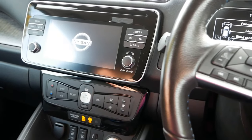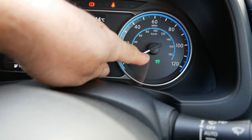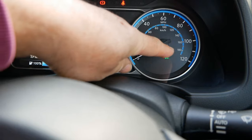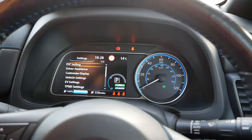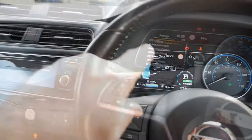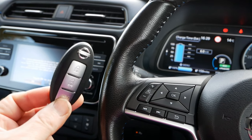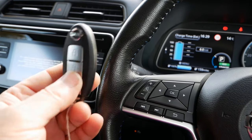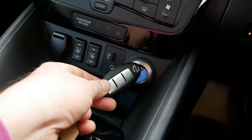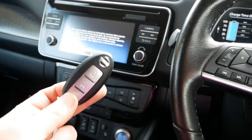When you're inside the vehicle, keep the key in your pocket, put your foot on the foot brake, and push the start button to make the vehicle start. Give it a good three or four seconds to allow it to boot up. When it's ready to go, you'll get a green light on the dash — all EVs have this green 'go' light showing the car can move. If a menu says it can't detect the key, the coin battery in the key is probably low. If you're out and about, hold the key over the start/stop button when you push it and it will probably start just fine.